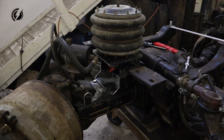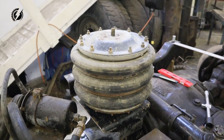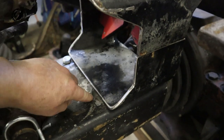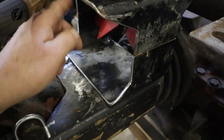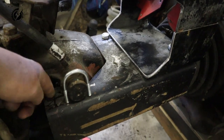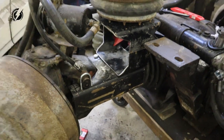Hey everybody, it's another day — this stuff is so time consuming. If you have ever done any vehicle build, you for sure feel my pain. But the results are incredible, I really like the results over here. So what we are going to do: cut a little bit more material here to have better access to these nuts, two holes for two bolts over here, make a brace inside to make it stronger, two more holes for this U-bolt, cut a little bit more material, trim the edges — and that will be it. Let's go work.